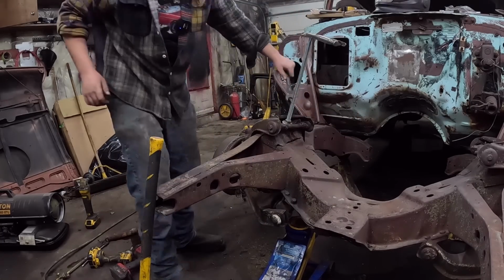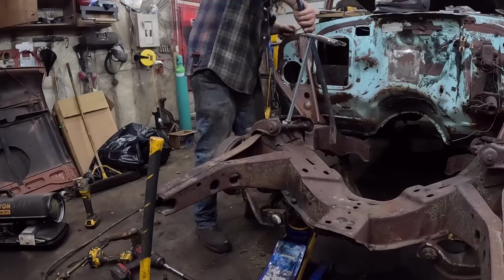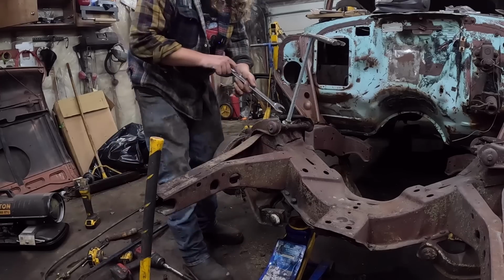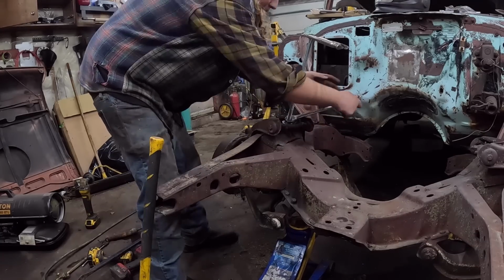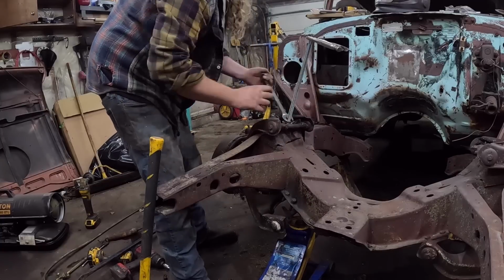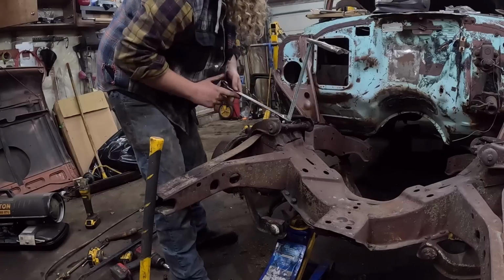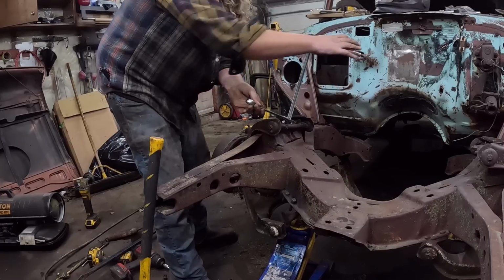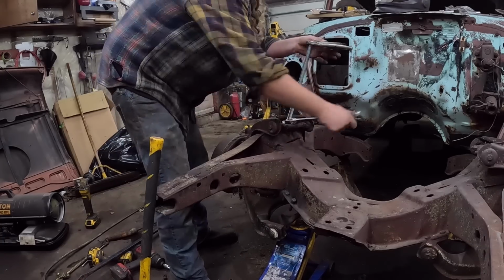Going in, okay. So you gotta just kind of walk it out of the bolts, which in this case were a disaster. This one out? Yeah, okay. We're fine. And as you go, obviously, the spring tension will get easier and easier. At one point I did make a socket on a pipe so you could ratchet this or impact it. But you know what? I hate coil springs. Springs in general, because they'll kill ya until you get the load off of them.